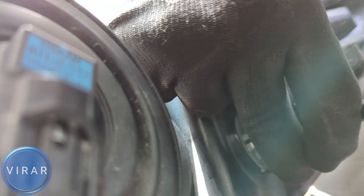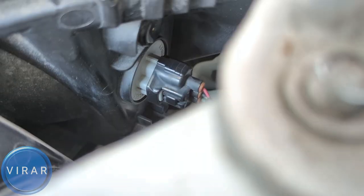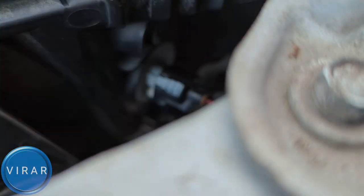This view is from the top — the camera's inside the hood. I'm going to put my hand and gradually twist it to the left. It's going to take a little bit of time because there's probably moisture, so the bulb holder won't just easily come loose — but it's going to take a few seconds. Twist it left just like that and now it's loose. Now the camera's looking from the top from outside — now it's unlocked. Get the bulb holder out and there it is.